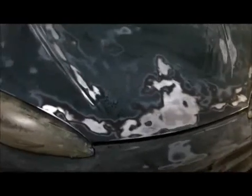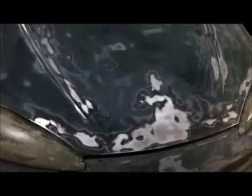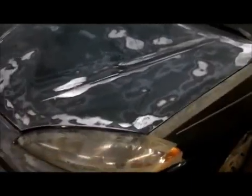And like I said, guys, I don't want to put a real thick primer on it. I'm probably just going to use the cheaper lacquer-based primer, or acrylic as they call it, okay? So what I'm going to do to eliminate as much shrinkage as possible, and shrinkage, I mean, a lot of times, guys, if you go ahead and paint a car and you feather edge all this stuff out of here and you prime it and you go ahead and paint it too fast, after that paint starts to cure, all this is going to show back up.